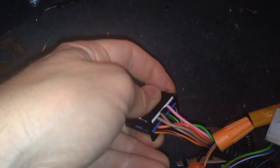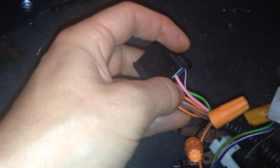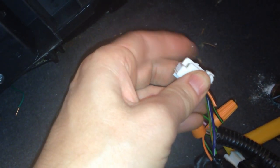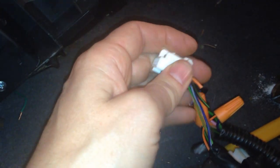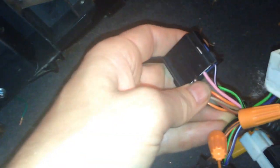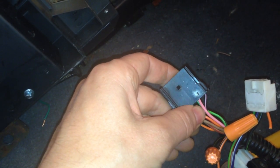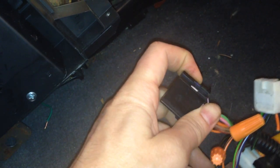Now to the wiring. This is the wiring harness that went into the seat belt controller module. After testing, I've realized that this pink wire has continuous 12-volt power to it. If you connect this to the seat belt wire, it'll release — as long as you have a good ground, you've got to connect it to the ground as well. But you don't want the pink wire because it's always got 12 volts, which means it'll eventually drain your battery. If you've got 12-volt power going to a servo for an extended period of time, it probably will eventually drain your battery.